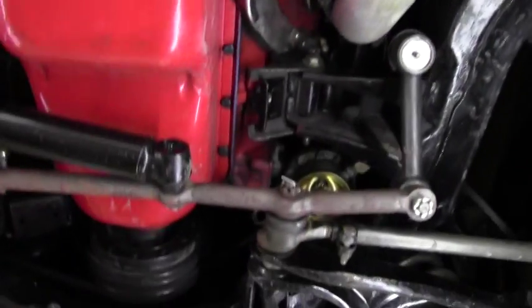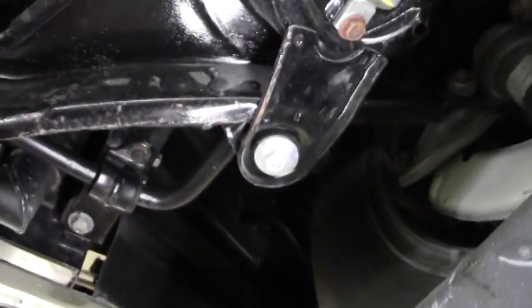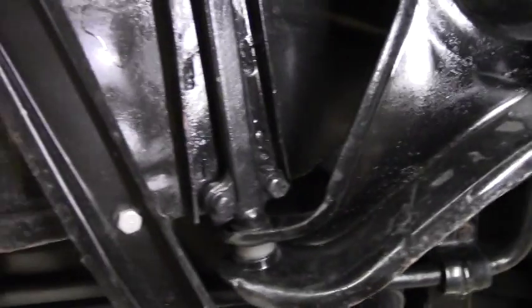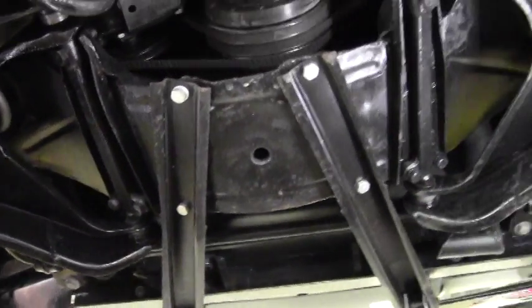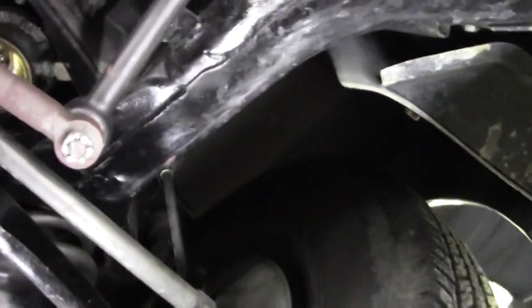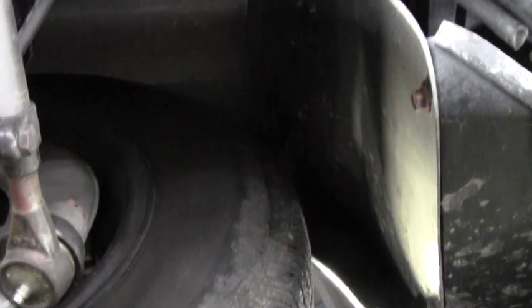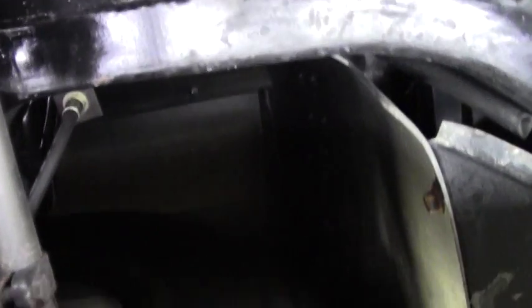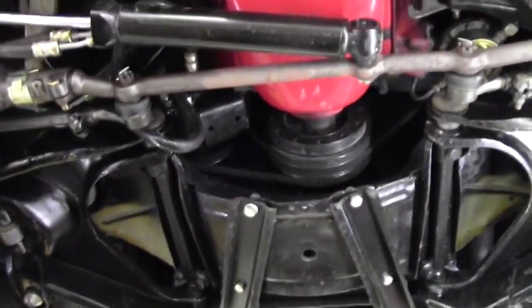Our A-arms in the front are in excellent shape, as well as the bushings, looking to be newer. Our radiator core support is in great shape as well. Up into the wheel wells, we do have bonding strips on both sides. And as you've probably heard me say in a lot of the videos, we look for the bonding strips. Our front valance is in excellent shape.